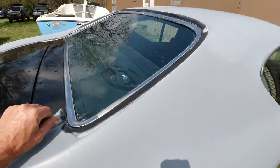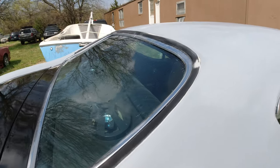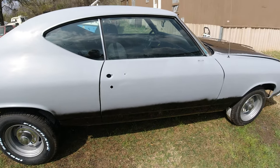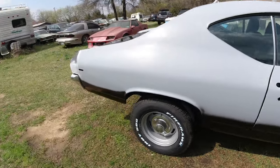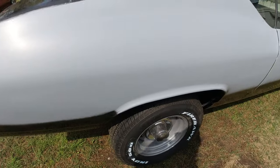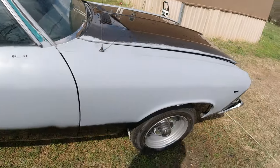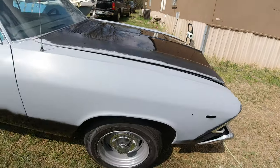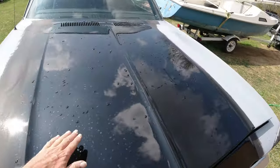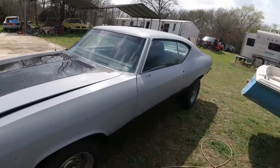As a good masker I can mask that chrome off, take a razor blade along the edges, and you can't even tell it was on there while painted. It'll take a lot less time putting stuff back on, and a lot less chance of scratching - try to put those moldings on and next thing you know you've got bare metal that'll rust. It's all painted underneath, there's silicone in there, and it won't ever rust. I'll come back with a video of me masking up the stripes.